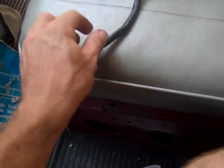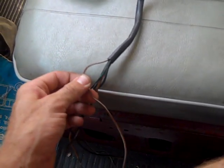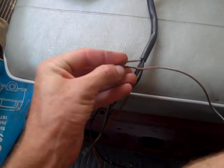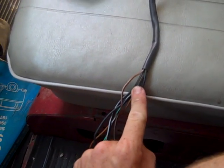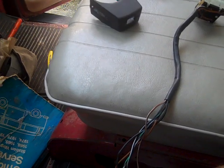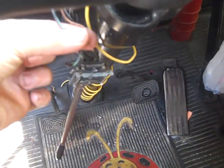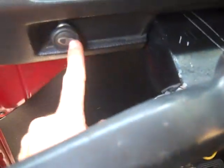Sometimes you'll find the harness and it'll be melted in a spot — if you crack it open you can see where one wire has burned. This is why you're supposed to disconnect your battery when working on this stuff, because it'll overheat, melt, and fray. The other problem is it may melt the next wire next to it and you've got two problems. It will save you a lot of headache if you unplug your battery before any electrical work. Even when you've gotten things loose, you still need to be cautious because these wires are hot.